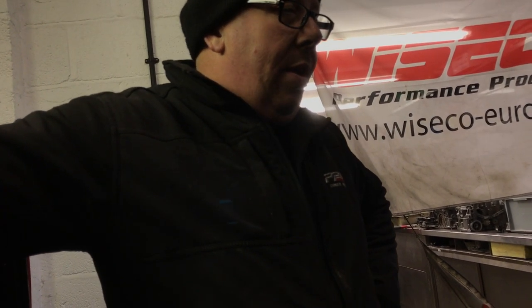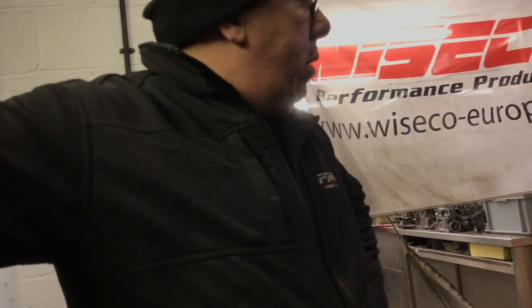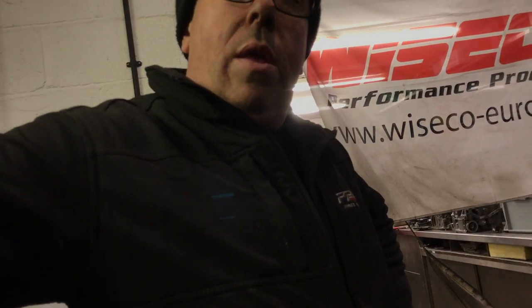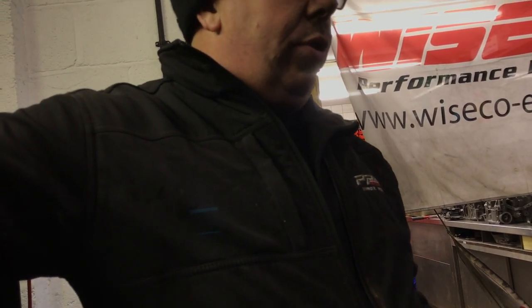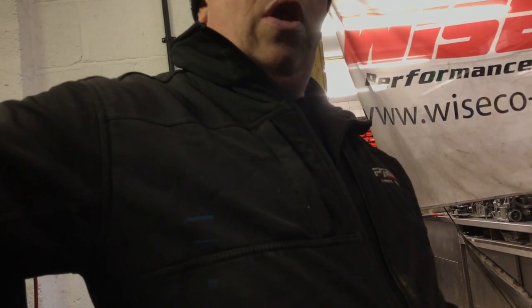A lot of people with this type of car tend to buy them, crash them around, give them a load of stick, sell them to somebody else, never service them. This idea that Subarus have got fragile engines isn't actually a thing. It's bad maintenance, nine times out of ten. So with the every 3,000, is that just the oil? Just the oil and filter, at least every 3,000. And the other components last a lot longer.